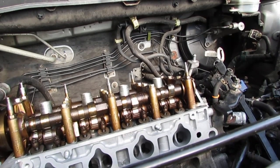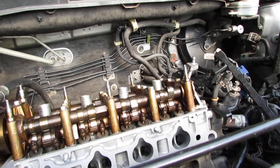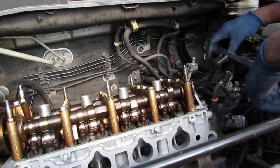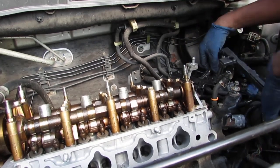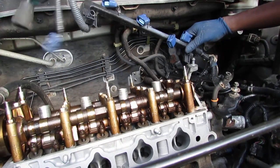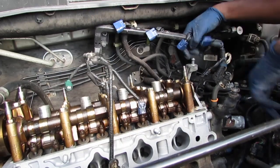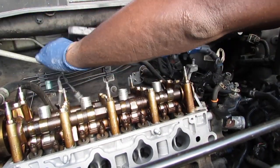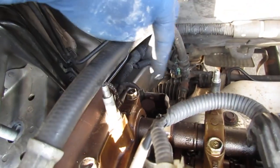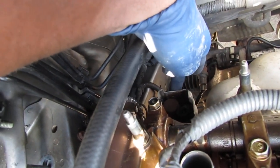Right, so we're going to get some harness back into position. This is all kinds of hoses here, injectors here. So we have what? 1, 2, 3, 4, 5 things to connect. All back here. Alright, so the green and the gray, these two are going to go right back here. Can't mess it up because of the shape. And then this tab goes into the back of the metal heat shield right here.